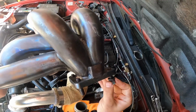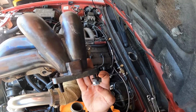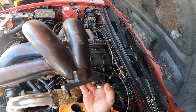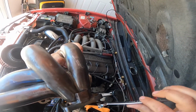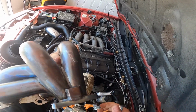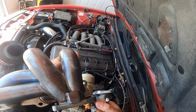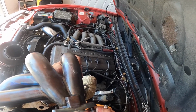So you're going to want to start with getting two nuts that fit the stud. I've already went ahead and put them on. You're gonna want to put one on right and one flipped. So you would need 2 wrenches. You want to tighten them down. So now, you can see my stud's already free spinning. Now you just get your wrench and start to twist it off, and it's coming. Oh, the nuts are coming. So let's just get them tightened back up. And there it comes. So yes, you might want to tighten them a little more than I just did, and then it will come off.